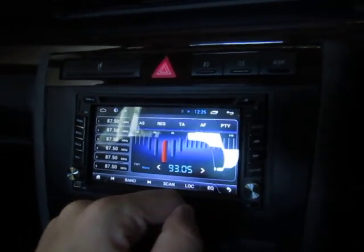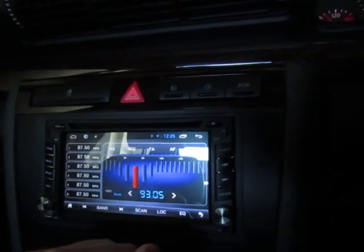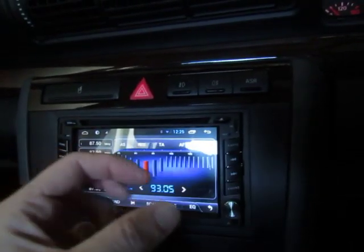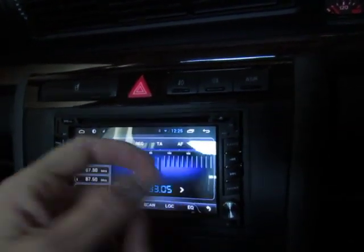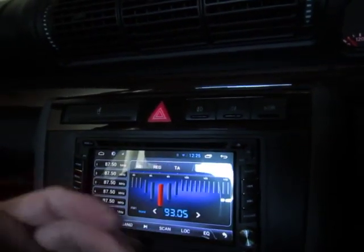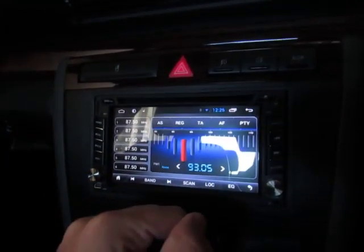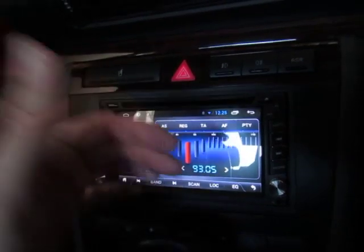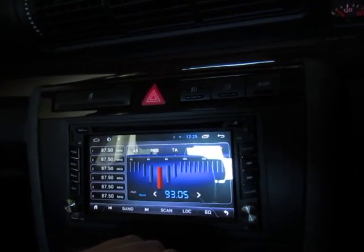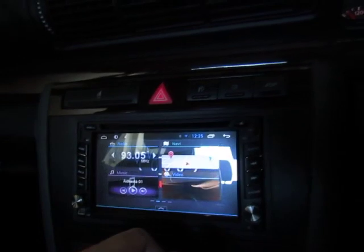So I have ordered one now on eBay. And when that comes, I'll have to haul this whole setup back out again and change that around and hook the blue wire that comes out of the antenna adapter to my 12 volt constant supply, so that the aerial is actually picking up a boost. And when I do, I'll be able to get some radio stations. It does pick up radio stations when I'm out of the garage. It's not too bad, but it's a bit crackly, and when you go under a bridge, you just lose radio completely. Not that I really worry about radio too much.